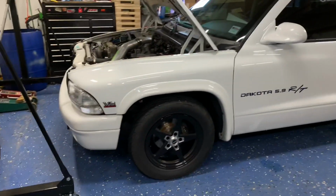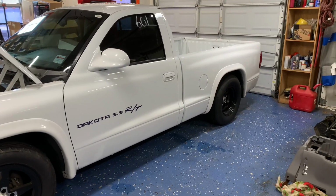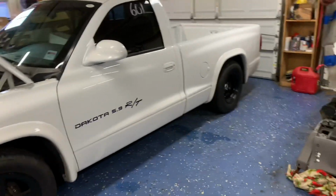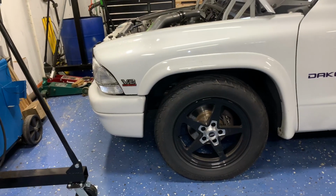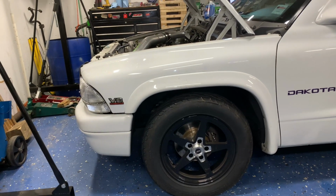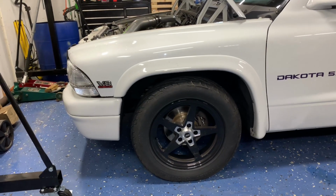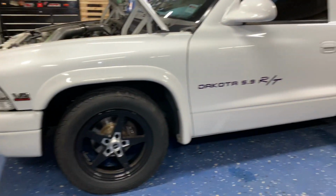What we didn't talk about, the suspension. So the suspension is set up for drag racing. It has CalTrac bars in the back with Calvert Racing mono leafs, Viking Warrior double adjustables in the rear that are actually in the stock location, which is something that's going to get changed shortly. As far as the front goes, the front has a Viking hybrid coilover. What that means is the top of that spring fits in the factory pocket, but the bottom is, I think, 2.5 inches and fits on the shock body just like a coilover in a car. It is also Warrior Series. It is also double adjustable.